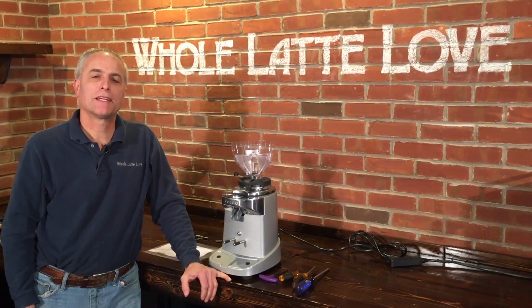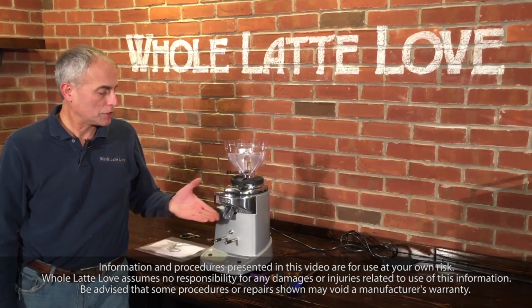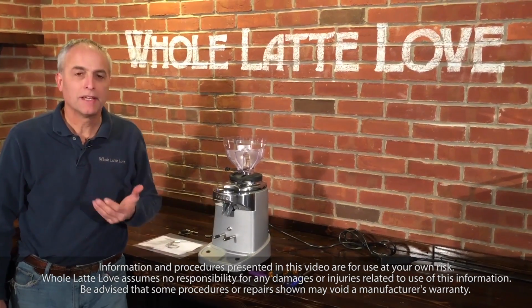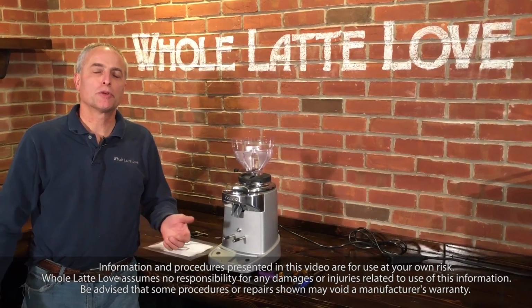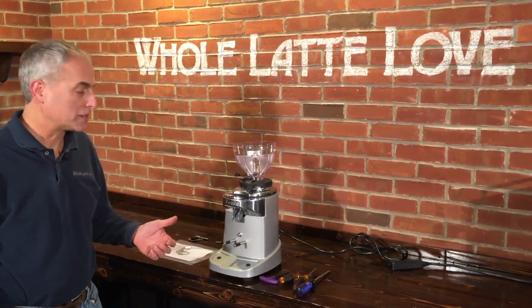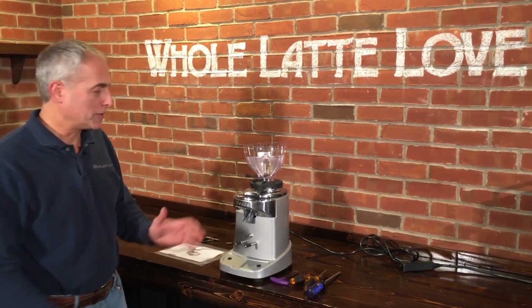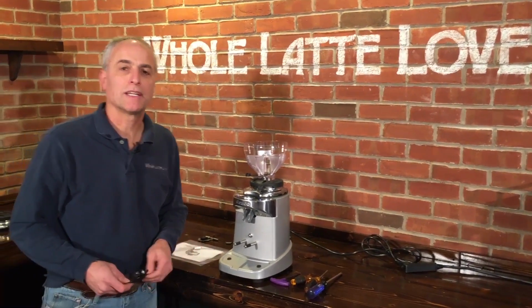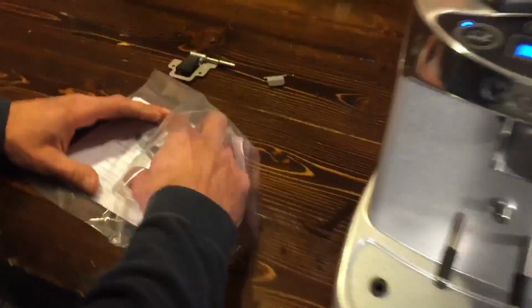Hi, I'm Todd with Whole Latte Love. If you have a Ceado E37S and you notice that you have coffee shooting out through the spouter or the opening and it's missing the portafilter, the problem you're having is that there's an old control in there, an SCC static control system, or an anti-clumping control system, that is an older style. They've come up with a new style to prevent that. This video is going to show you how to get in there and replace that. It's relatively easy to do. Let me show you what they look like.